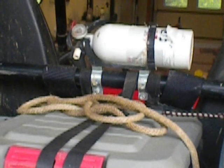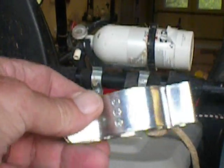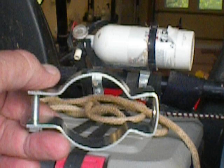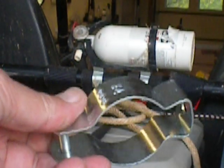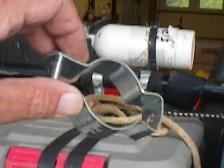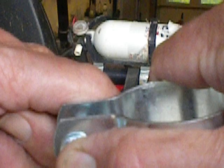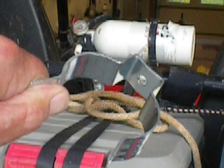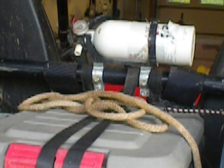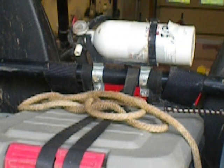So what I did about three years ago, being an electrician, I came up with a clamp — a No. 4 conduit clamp. You can buy these at Home Depot, Lowe's, or an electrical supply house. It's a 1½-inch electrical conduit clamp, about $2 a piece, and they come with a carriage bolt and a nut. You can open them up, slide them around your inch-and-three-quarter roll cage, and squeeze them back down. They fit the roll cage like they were built for it — it's just a different method of measurement on the conduit versus the roll bar material.